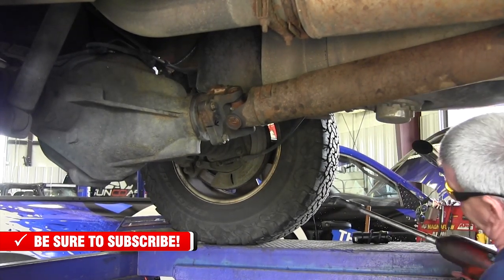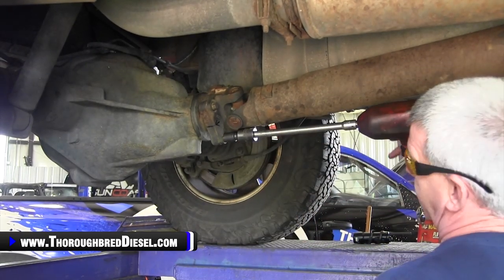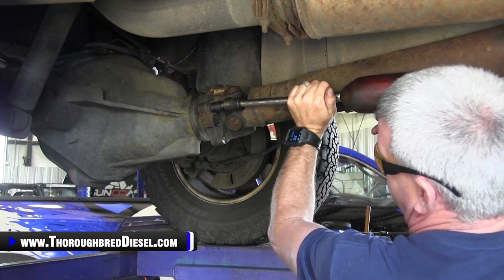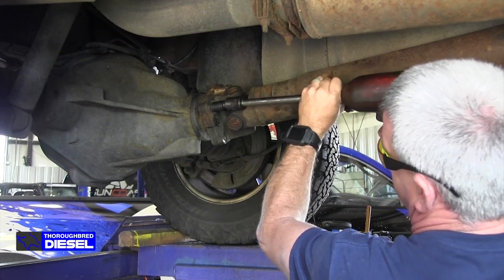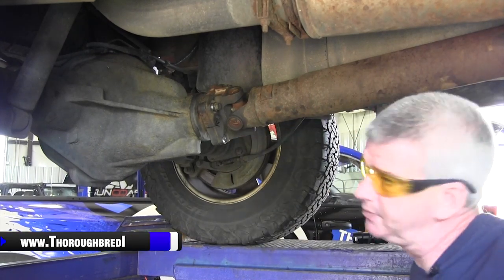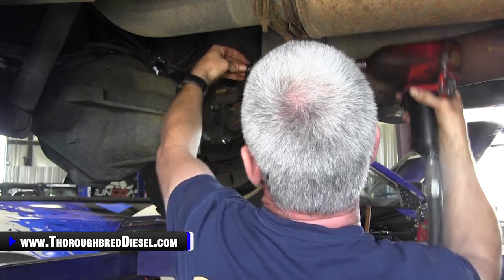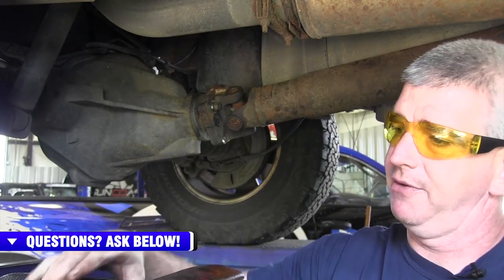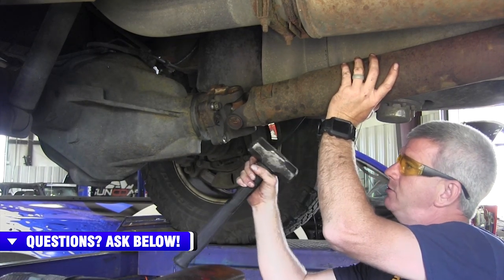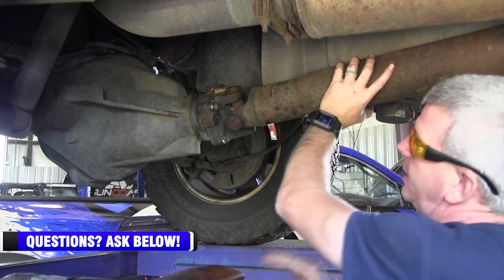Then I'm going to go ahead and pull out the bolts for the rear drive shaft. They're metric 15s — an impact swivel makes it really, really nice. I'll leave one bolt in it. I'll run that bolt about halfway out and kind of tap around it. Don't hit the U-joint ears or the bolt hole ears, just kind of tap around the top side of it there and that gets it loose.